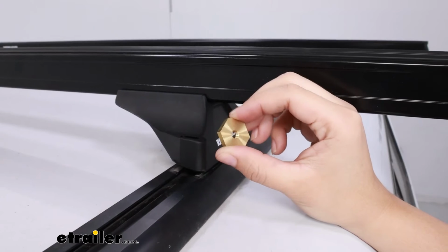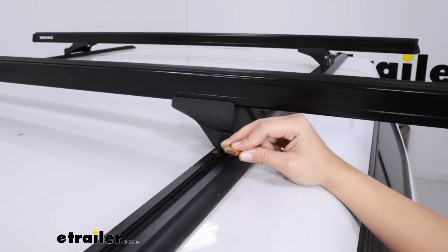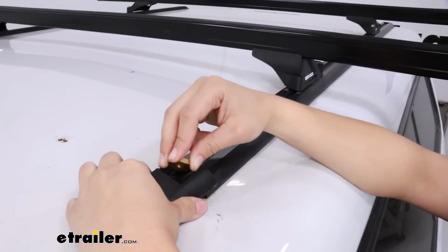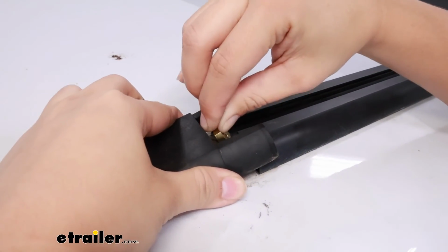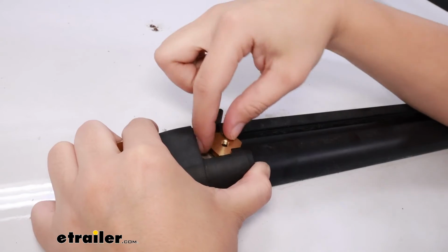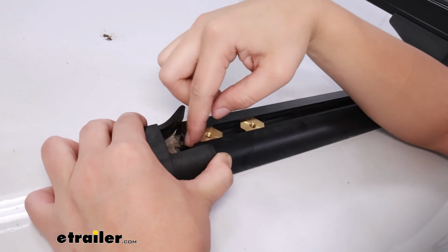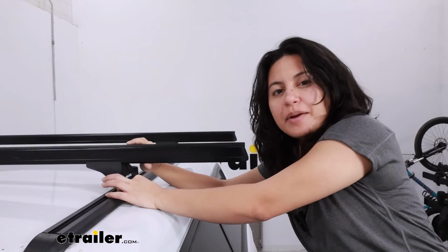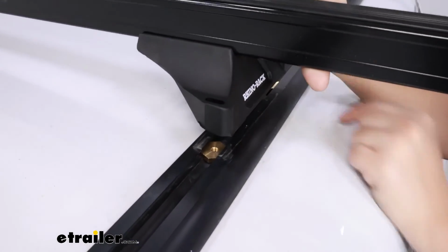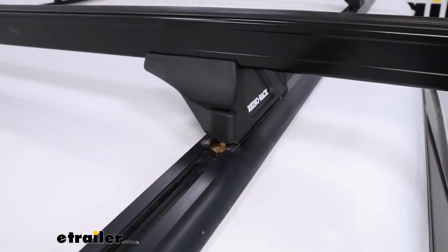Secure the towers with these hex nuts. Now, these are gonna have to slide into your track system. On one side of the tracks, there is gonna be an opening that you can just fit these into. On the other side, there might not be an opening, but you can slide the end cap out to make space for these nuts. Lifting up on the crossbar, we're then going to slide these nuts in the general direction of where they need to go. You're going to want to fit on the outside of those tabs, and if in doubt, further away is better than closer inside.